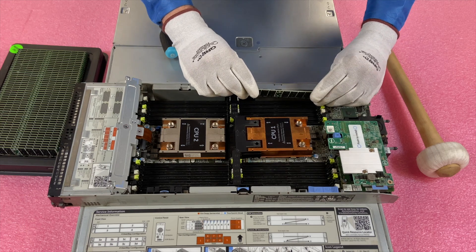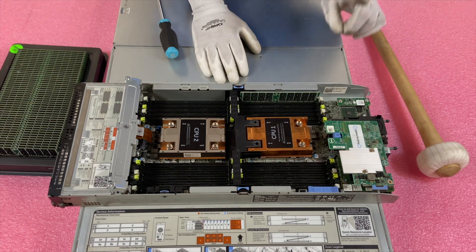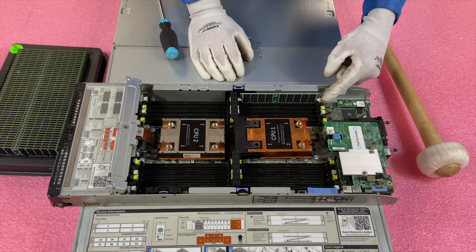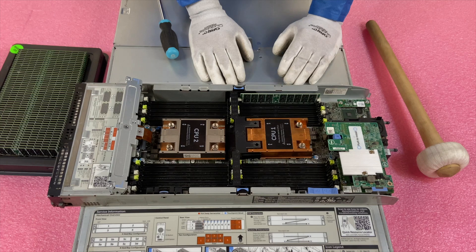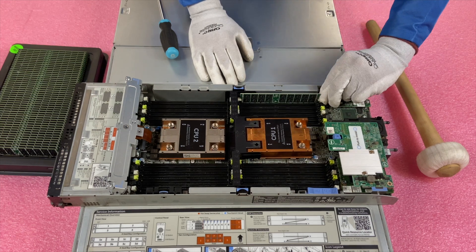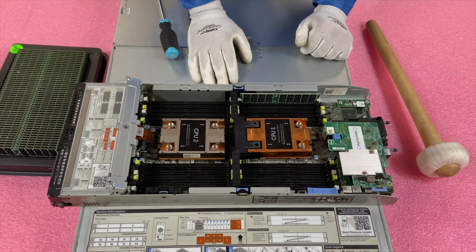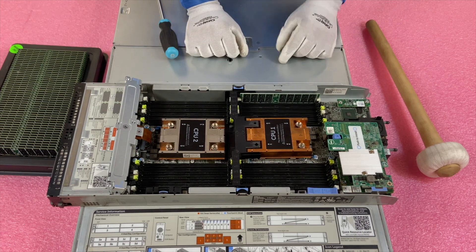I'm going to go ahead and install this here into A1. You'll notice I'm not holding the module — the module is in there but not fully seated. You can see the tabs here are still sticking out. You want to hear two clicks. Those two clicks let you know the module is fully inserted. You'll notice this tab is completely inserted versus the rest — this is what you need to look for. This is the number one user error we see: someone loads up a bunch of modules and one is just slightly off, not fully seated, so the module won't register with the board and will appear as a bad DIMM. When that happens, just rotate your DIMMs around and most of the time it's a seating error that gets resolved.